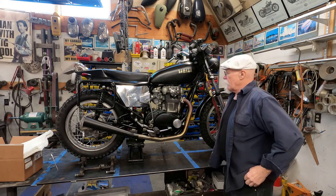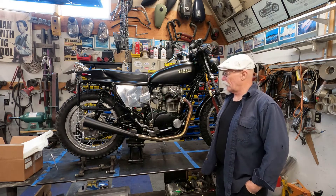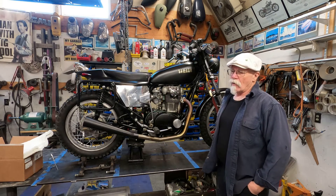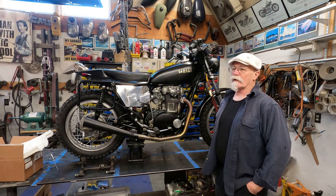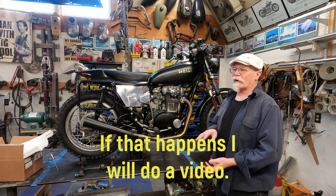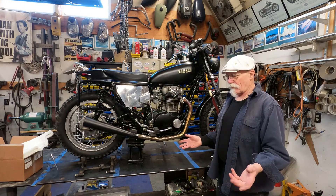So this is where we're at. It needs to go for a test ride to see how everything is doing. I did run into a slight problem testing it — it wouldn't go into first gear properly. I don't know if I've got a little bit of clutch drag or if I literally have a problem with the dog on the shifting forks. If that's the case, the engine will have to come out again — I'll have to turn it upside down, pop the bottom off, pull the shifting drum out, and figure out what's going on.